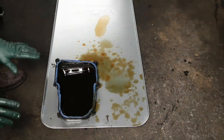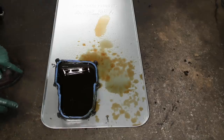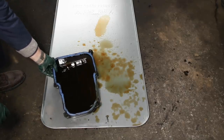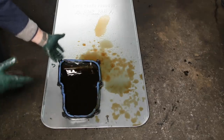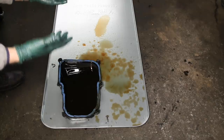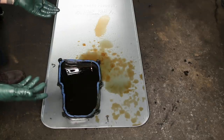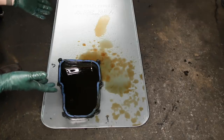Here's a couple words of caution if you're going to remove your transmission fluid pan. When you pull that little plug to drain it, it does not get all the fluid out. Be very careful when you lower the pan down that you don't tip it or you're going to get transmission fluid all over yourself or the floor. Make sure you put a large drip pan underneath the transmission.